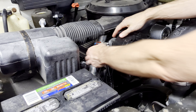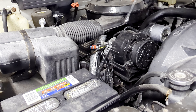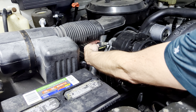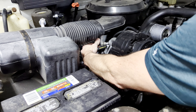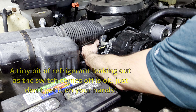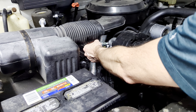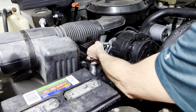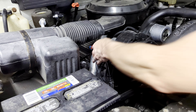To do this I just need to take off this electrical connection — there's a tab that pulls up and then you slide off the electrical connector. Then it's just a 14 millimeter wrench to loosen this right off. This one is a $25 part, a little more expensive than I like for the parts cannon. However, if it's possible that I could fix this just by switching out this switch, for $25 and not having to open the system — if this fixes it, great; if not, I know I've got a new switch and it's not causing problems. It just makes sense to do it.